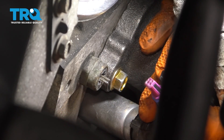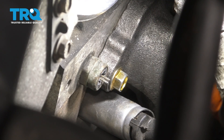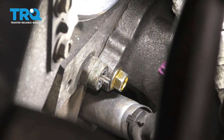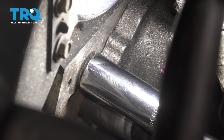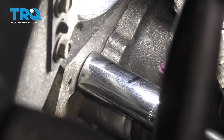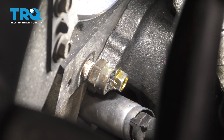Let's take this out now. Keep in mind there is coolant behind it, so I have a collection bucket ready to catch all the coolant that drains. I should also have the new sensor ready. I'm going to stick a 19 millimeter socket up here and remove the sensor.